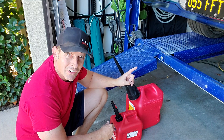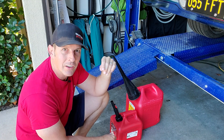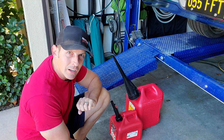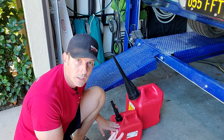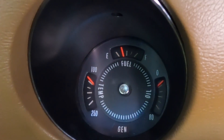Time to put the fuel back in the car. I'm going to key on the ignition so I can watch the gauge on the other camera, and I'll announce each gallon as I go — one gallon, two gallons, three gallons. It'll take me about half an hour since I have to transfer fuel out of the old tank, but it should take you guys about 15 seconds here. I'm using a two-gallon jug, so every two gallons will be accurate. One gallon, two, three, four, five, six, seven, eight, nine, ten — almost 11 gallons in total, which is almost halfway. I'll go back through the footage and document where the gauge was at each gallon for my reference.